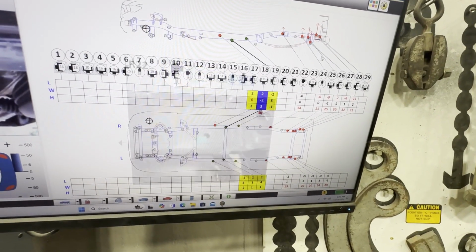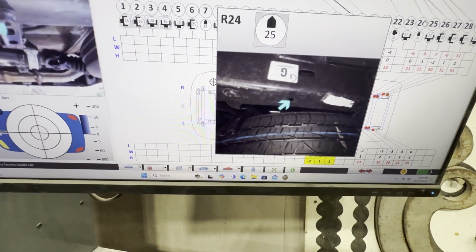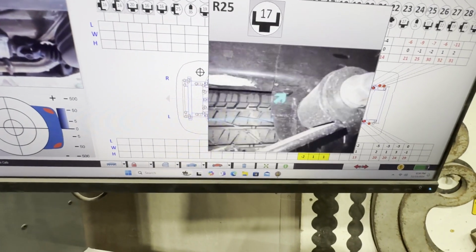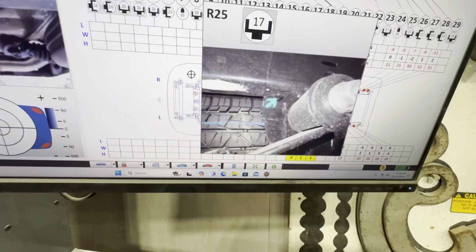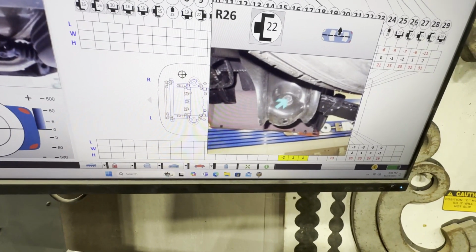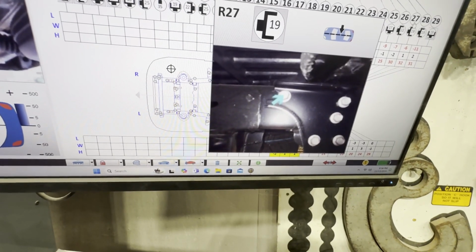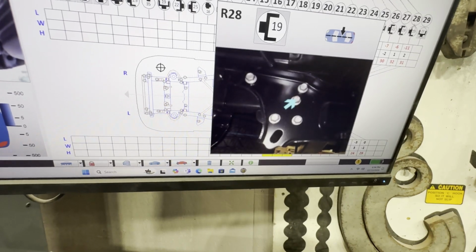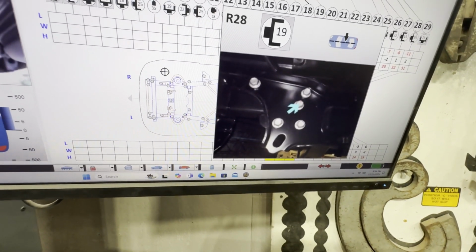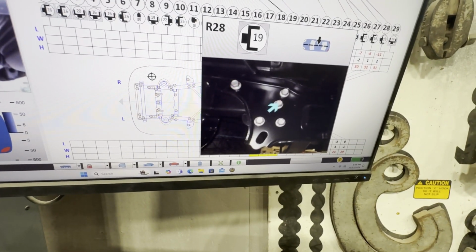And that point is, let's see, that's that point, which is the actual frame itself. So 1 mil out on that. That's the rivet. That's 9. So that's 4 on that. That's the bolt. That's 7. So that's only 2. That's another bolt. That's 6. And this is a bolt that would pivot more because of the way it is, I would assume. So that's 11.